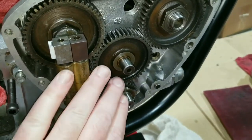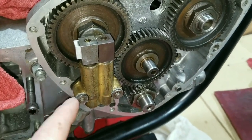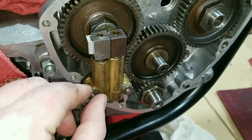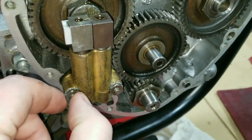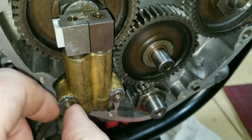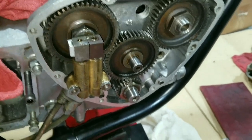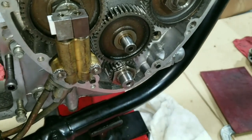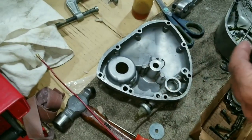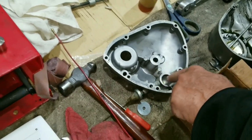We got this all tightened down — went to 70 foot-pounds. Then we tightened the nuts on the oil pump; they were at 5 foot-pounds. They're kind of a bugger to do because the pump body blocks off the flats and you have to work at a weird angle, but we got it without damaging the nuts much. Next we're going to work on the timing cover, putting in the seals — there are two seals.